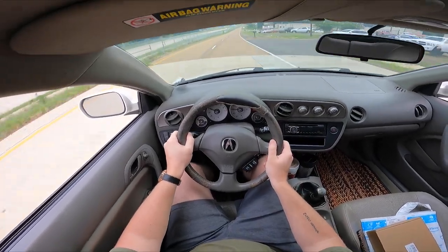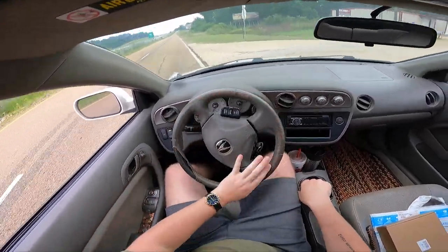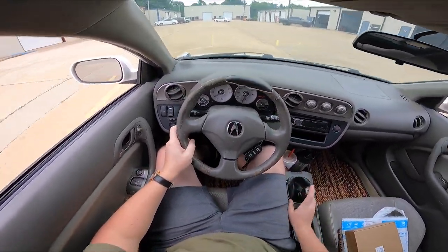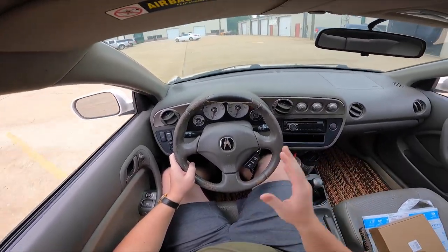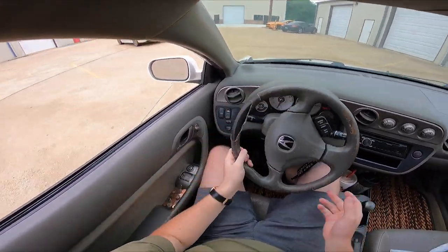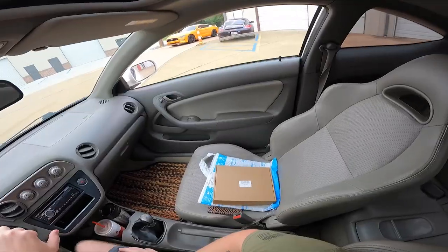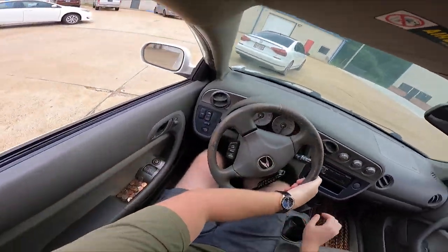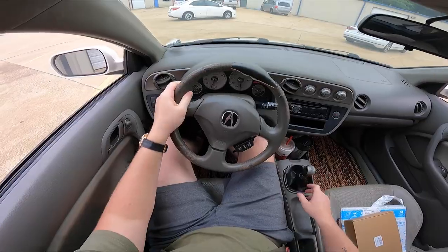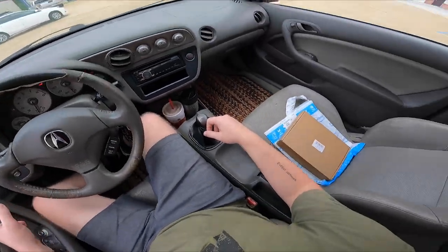Weird. Ooh. Okay. Interesting. So there is a very interesting noise whenever the car gets into VTEC. I'm pretty sure these engines get to VTEC at like 5,500 RPM. And you can hear it. You can really hear whenever it starts. I don't know if that noise I was hearing was just the change in intake, because the car does have an intake on it, so you're gonna hear it a little bit more. But regardless, I don't know if that noise is something I was supposed to be hearing, but one of the things that we're gonna be doing to the car soon will be adjusting the valves to make sure that all the clearances are right inside of the engine. So whenever we get to that next time, it'll be a little bit invasive. But anyways, that was dope. The car has been doing really well.